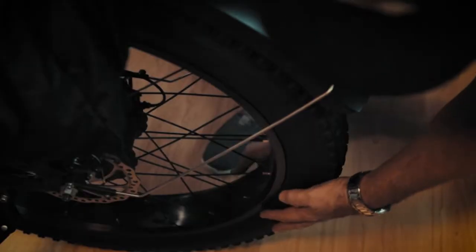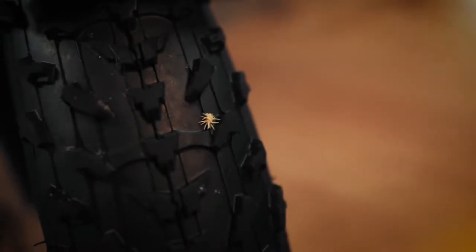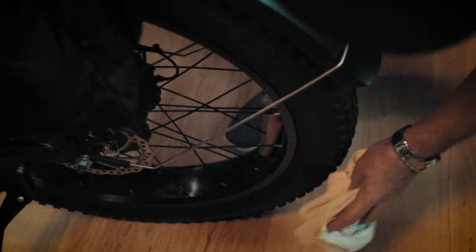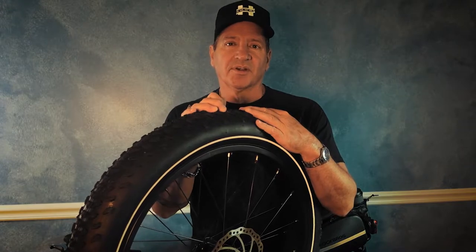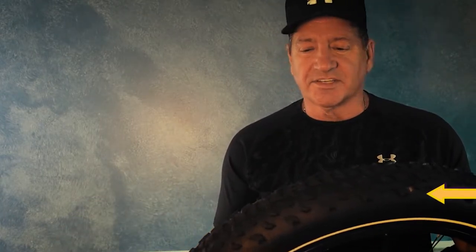The first thing is before you head out, take a good look at your tires. Give them a once over very quickly for any debris that may be lodged in the treads. Fat tires have a knobby tread and they can easily pick up thorns, twigs, plastic, broken glass, and things lying between the knobs or in the grooves of the tread. At the moment it may not be penetrating the inner tube, but if you ride for a few hours there's a good chance you can work that through the rubber exterior and into the inner tube. So give it a once over, knock and brush everything off, and make sure you don't have any sharp objects stuck to your tire.